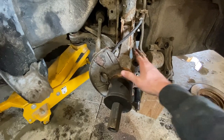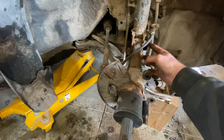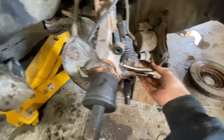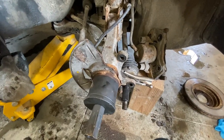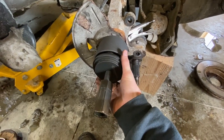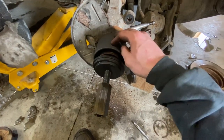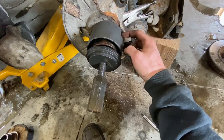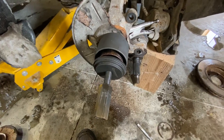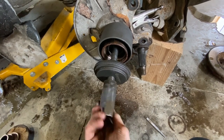To help keep this more solid since you are putting a ton of torque on it, I kind of sort of reassembled it here and just stuck the bolts in without tightening the nuts down, just to make this solid, and just crank away. To get the bearing all the way out, I ended up turning this around so it could slide out. I ended up using the big one, which I think slipped over the top of the hub, so I may have to try to pound it off somehow. But there is our bearing — it's out.